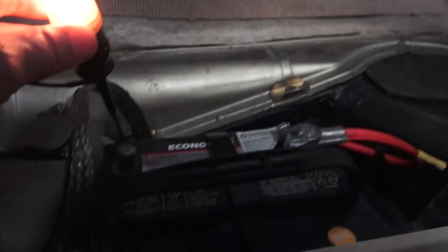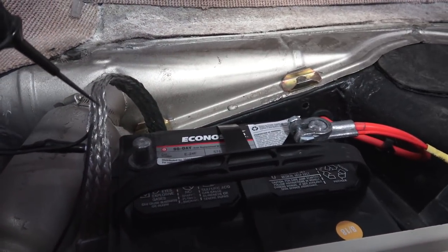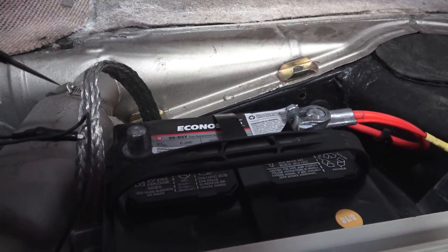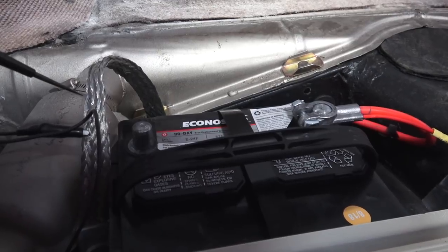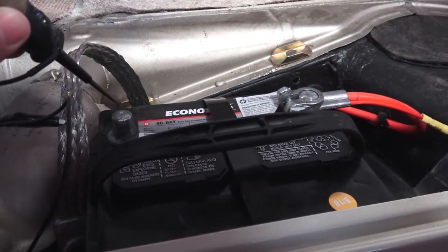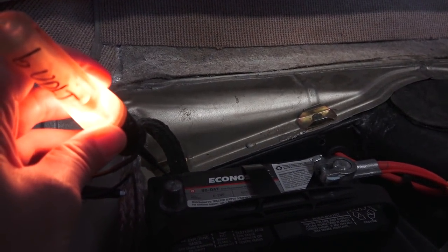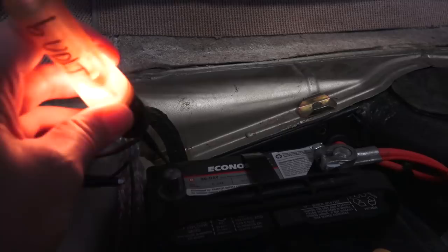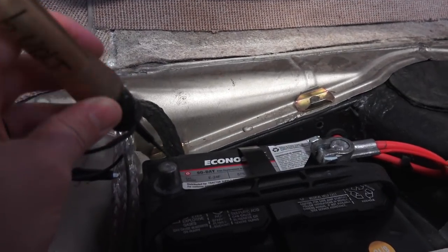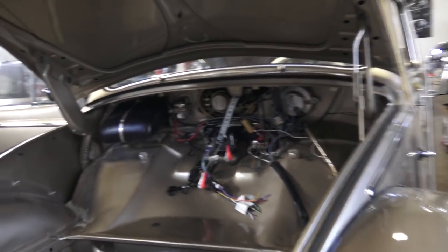So this is how you do it: take off your ground connector to the battery and put the alligator clip to the ground strap or to a ground on the car, then test it and see if the light comes on. We want this light to NOT come on when I touch it to the battery negative. So let's come here to the trunk area of the beetle.